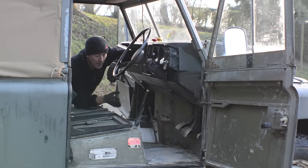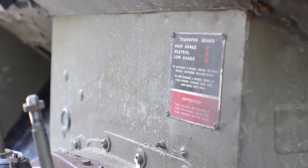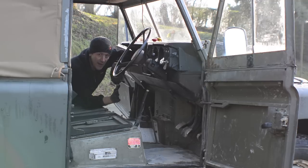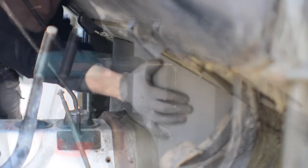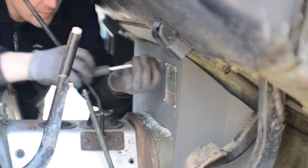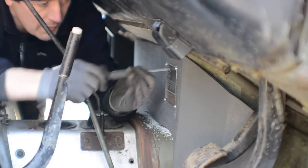The bulkhead panel is self-supporting, meaning you don't need to glue it — it just sits on there. What we're going to do, as they advise, is remove the four-wheel drive instruction plate and use that to pin the mat back onto the bulkhead. I'd quite like to have that on there anyway and it will just add a bit more security. So we simply slide the bulkhead mat in place and then use stainless self-tapping screws to gently pin that plaque onto the bulkhead.